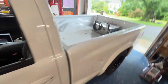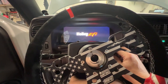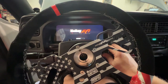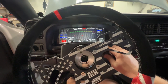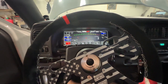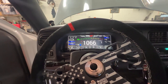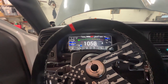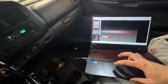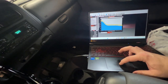All our injectors are plugged back in. We took the Holley and updated it with the new injector information. It's ready to go. Give this thing a crank and see what happens. So there we go — it's adding 14%. I probably have to go in here and make some changes. It's still adding a lot of fuel — it's running really, really lean. Fuel modifiers.